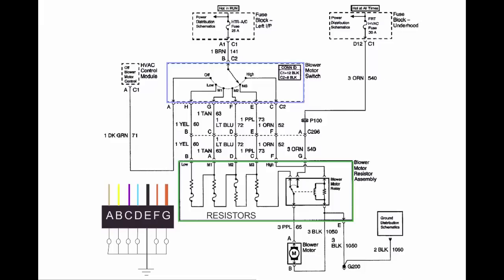So let's look at the first one here. This is the under the fuse hood. In my case, it's a 30 amp. They increased it in later years, so you'll have to consult your own booklets or whatever to find out which fuse it is. But this is a battery connection, hot at all times, and that is on pin G. In my truck, it's a fat orange wire. Later years, they decided to make it a fat red wire, which makes a lot more sense. But in my case, it's an orange one.